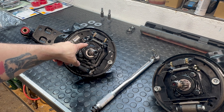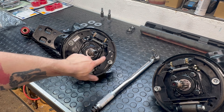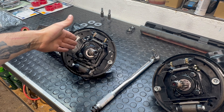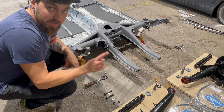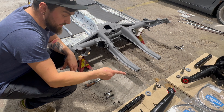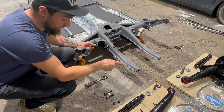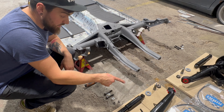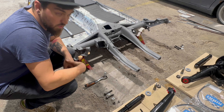It's time for the second one — boom, there we go guys, they are ready. I found a way to torque this down — I found a socket with much thinner walls, and they are now torqued to spec, which is 43 foot-pounds or 60 Newton-meters. The diagonal arms are ready, so let's mount them onto the chassis. I think we will mount the top part of the shock to the frame, put the diagonal arm in place, secure it with that big bolt, and after that mount the bottom part of the shock to the diagonal arm.